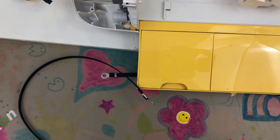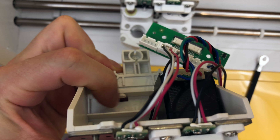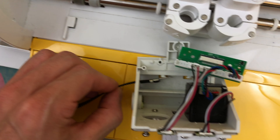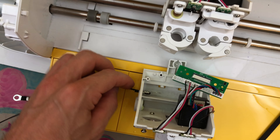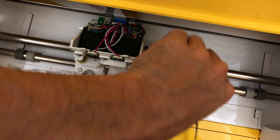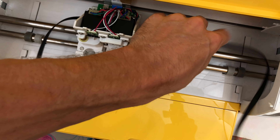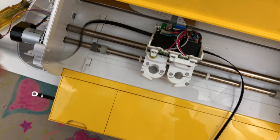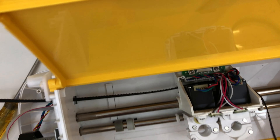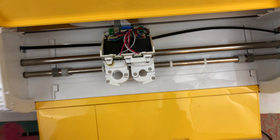Here is what that mechanism looks like — it's a little bit taken apart. The belt is connected onto that little circle thing there and that circle thing there. One end goes through there and clicks on to there. To get the belt back on, string it through like so, and make sure the teeth are facing towards the back of the machine, then string it through each side. You don't need to take the carriage off; if it's too hard with the carriage on you might want to, but I wouldn't recommend it.